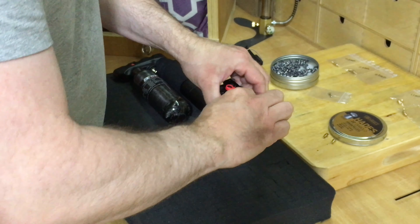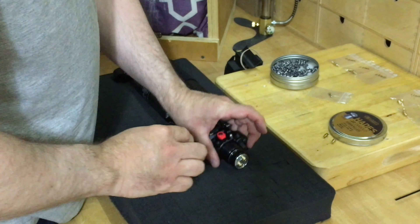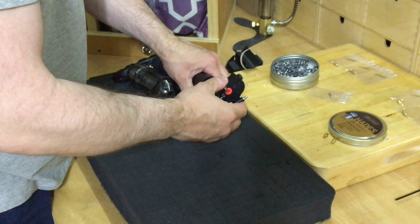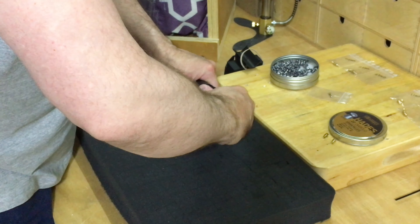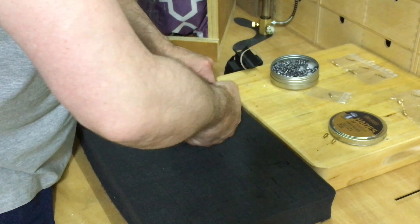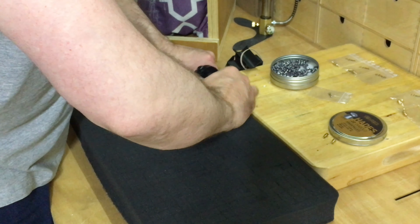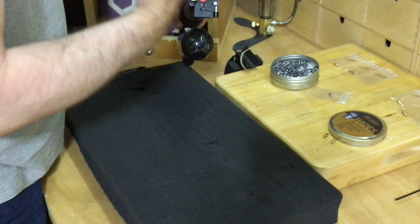Just make sure you wipe off any excess. Each jet is tight so we'll now get that back in. When you're first going in, just allow for the larger O-ring — push it in gently. Once you feel it's getting into the correct position it will pick up on the thread. Make sure you're not cross-threading anything; that's going in nicely. This will actually come to a stop once it doesn't want to go around anymore. You can see it's stopped in that position and it is aligned and straight.